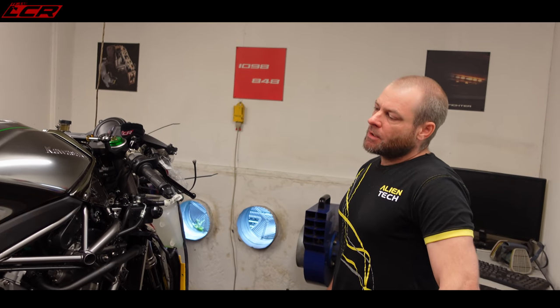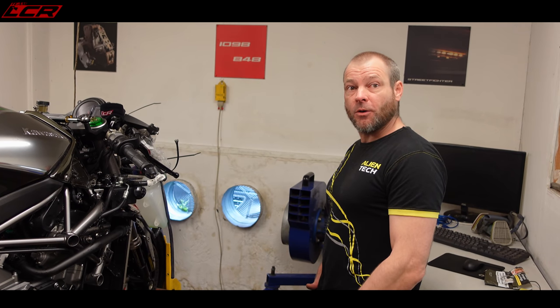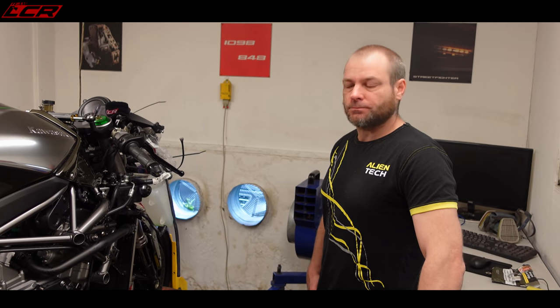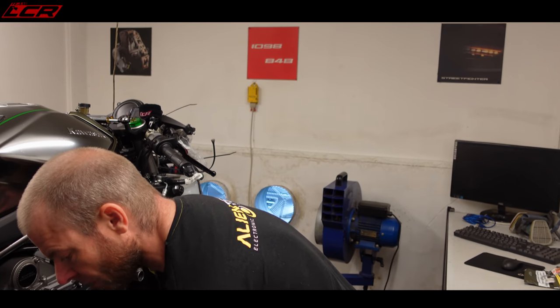So the trend now is to re-enable the fuel cut, to switch it back on. I guess that was an emissions type thing. Yeah, that's it. And to save fuel when you let the throttle off. Yeah, okay. But that's probably what I'm feeling, that initial pick up again, really snatchy.